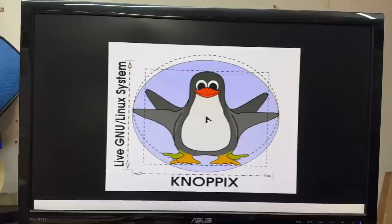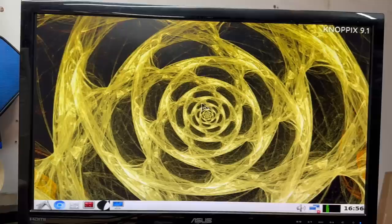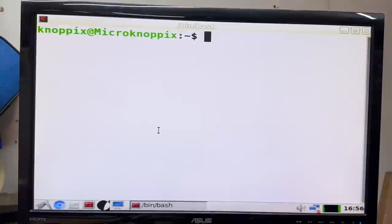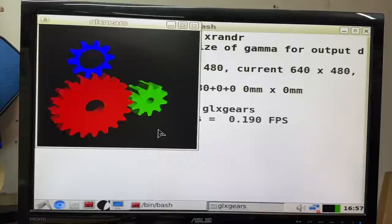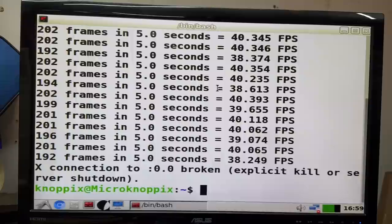Which means that sound card works. We are there. Looks like we're stuck in 640x480 mode, but let's go ahead and open the terminal. Let's see our resolution options — yep, 640x480 is all we get. Now let's test that graphics card — should be able to run GLX gears. And it is. We can see we're getting stable frame rates, which means 3D acceleration on this GPU is working. We just confirmed that the video card and the sound card are good. So that's good enough for me. Let's go ahead and shut down.